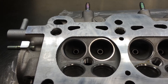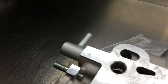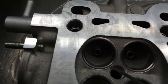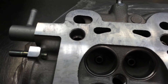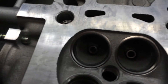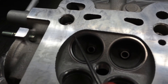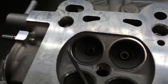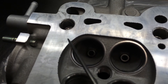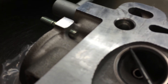What we want to talk about is the different areas — or different components — that make up the valve relief cut. The valve relief cut is this cut all the way around here. There are several components to a cut. The first component would be the diameter, and specified in the rules we have a max diameter, defined for this cut all the way around. The cut also has a sidewall to it — this stuff is really small and hard to see.